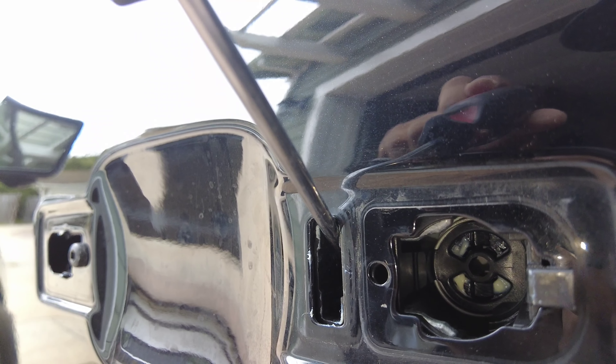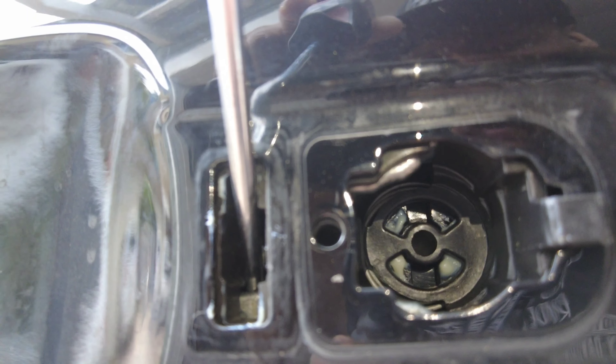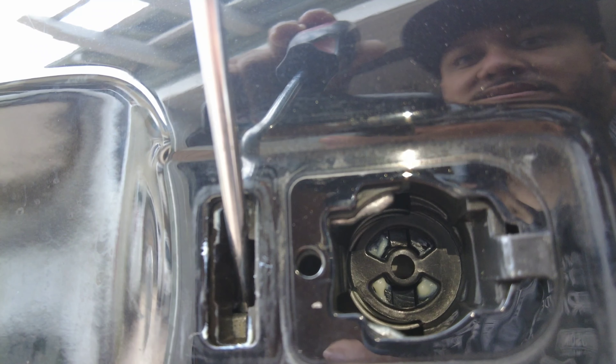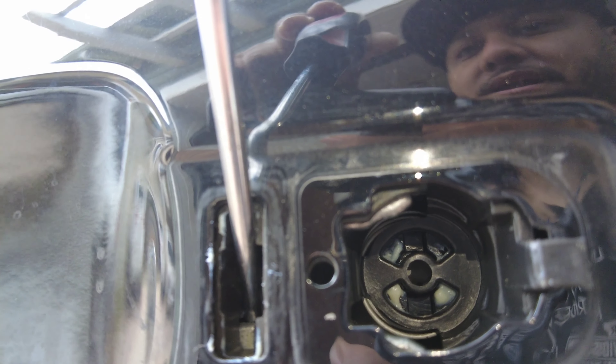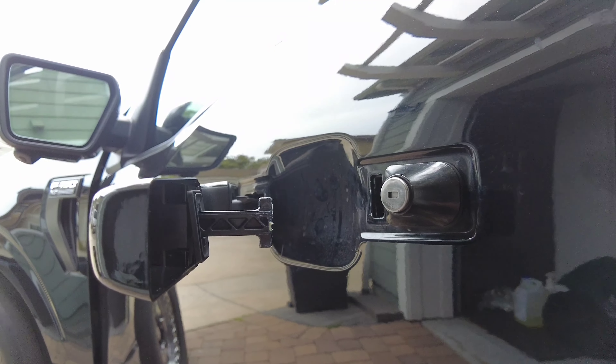You don't need to tear down the doors. All you got to do is put the flat screwdriver behind there and slowly press up. You'll see that little arm in there move all the way forward. All you got to do is push it down and slide it forward, adjusting at the same time so it locks out of the hole all the way, and allows you to put the handle back on.